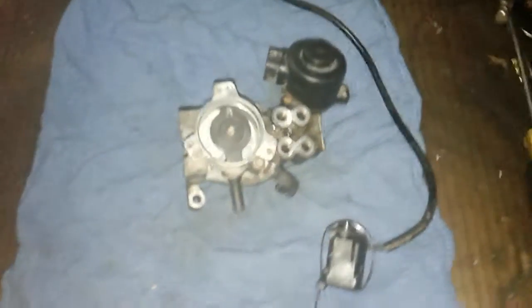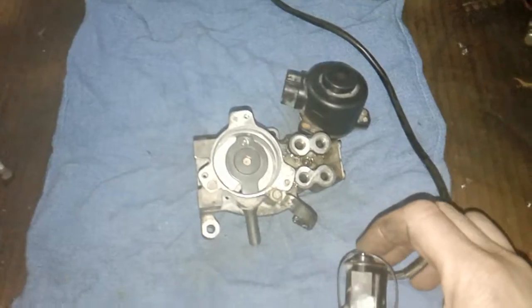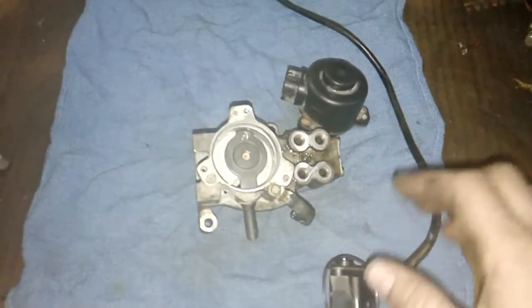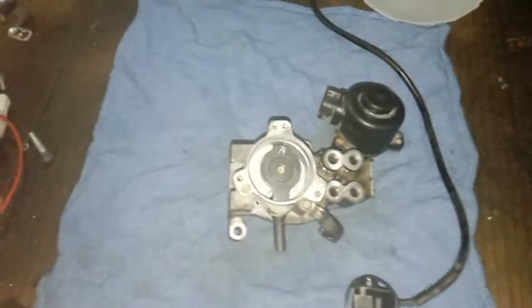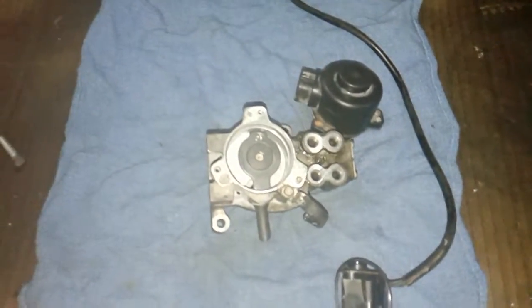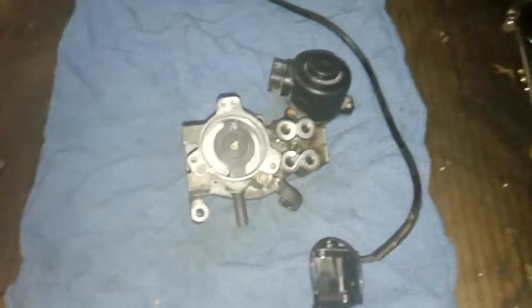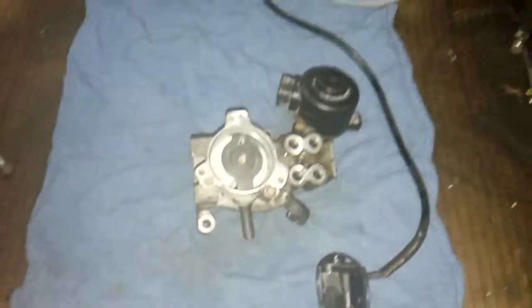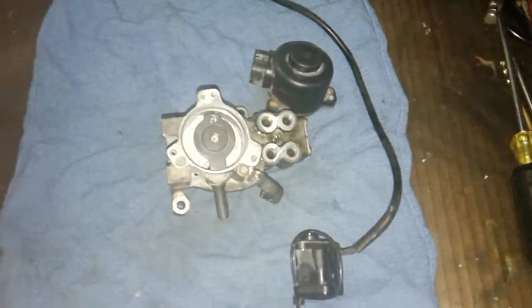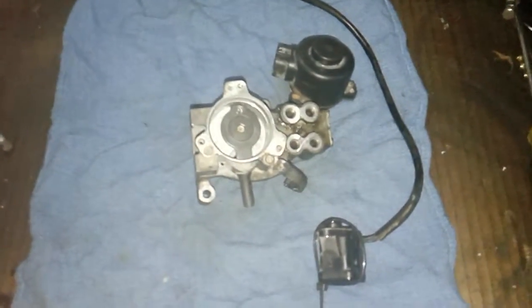There's another option: we could plate it off, shut down the pump entirely, pre-mix, and tie up the resistor to fool the computer into thinking we were getting plenty of oil. But I'm going to leave this system on there — I don't want the customer having to pre-mix, so we're going to force oil into the engine as it should be, just giving it additional flow. The catalytic converter has already been gutted, so we don't have a problem there.